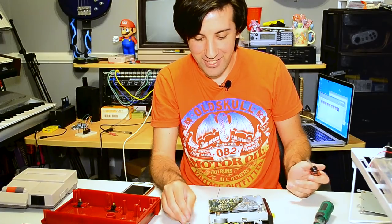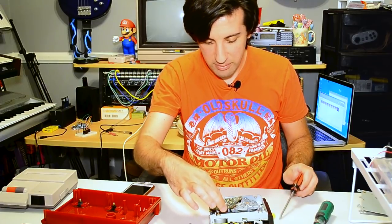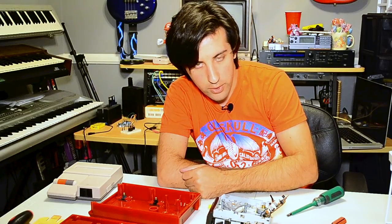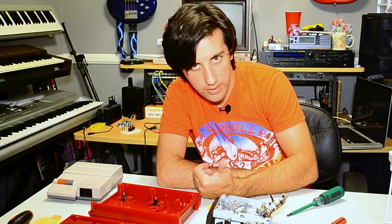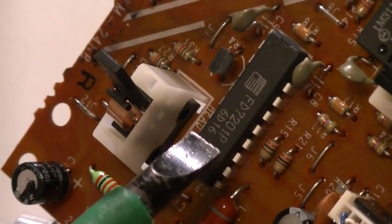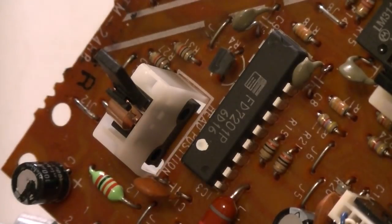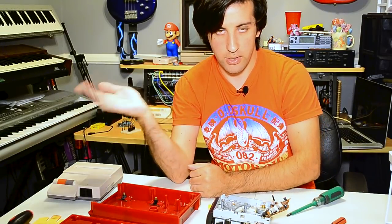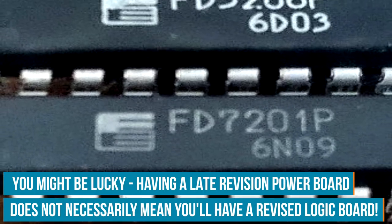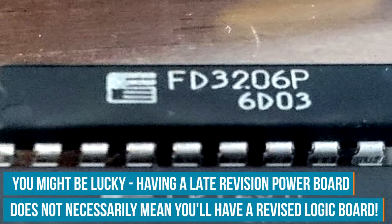Let's take a look at the logic board. There are a lot of mechanical little switches on this thing that have to do with how the drive auto-homes itself — when mechanical components reach their limit they activate these switches to tell the system to stop moving. This is the FD7201P, whose main purpose was to convert the digital signals coming from the RAM adapter into an analog signal that the mechanical components could understand. Nintendo did release another revision of this chip that added an additional stage of logic which prevented you from being able to rewrite the entire disk.